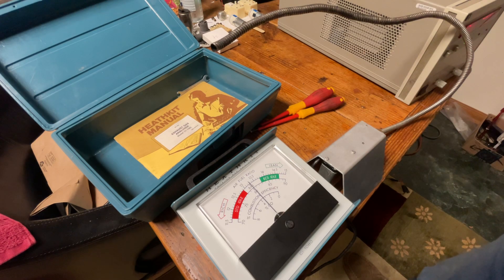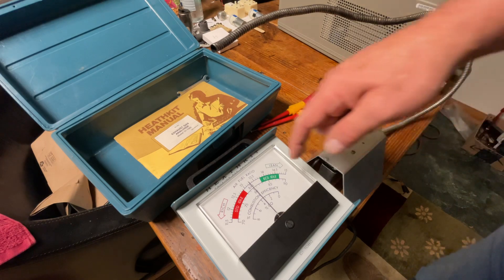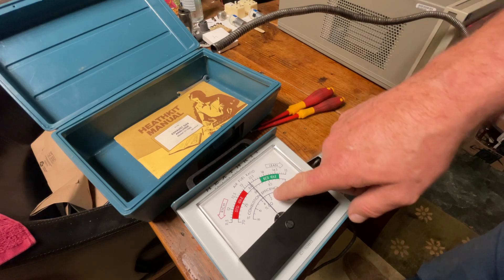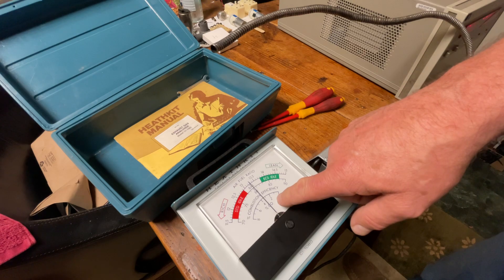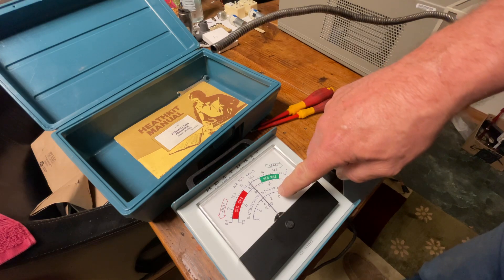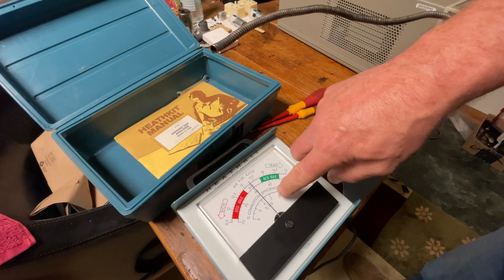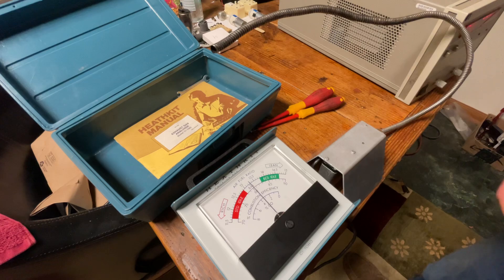You want to be behind the other side of the exhaust gases. Then you turn on the engine and let the car run to operating temperature. You will see that the number is going to drop down, and you are reading the CO level — the lowest number here. Ideally on 4- and 6-cylinder engines, 0.5. On the V8s, between 1 to 2 — you definitely want to stay below 2 on the V8s.